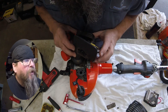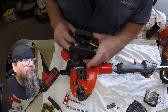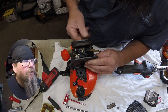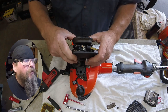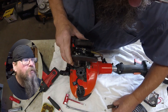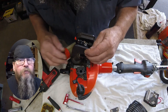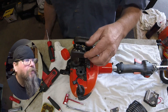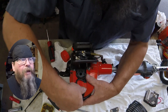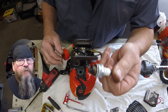Pull the carburetor out of the way — there's water sitting on the intake. The problem I'm going to have is that I thought I had some isopropyl alcohol and I was going to pour it right into the engine, roll the engine over, and try to absorb as much moisture as I could. But it turns out I was all out of that. When I dug in the toolbox to see what I did have, the only thing I came up with was Sea Foam.